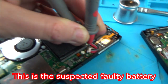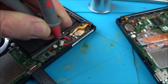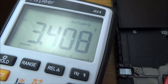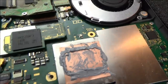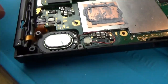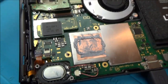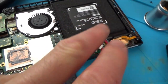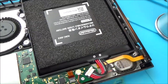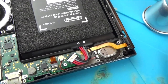Just before messing with the LCD screen, I'm going to leave it plugged in for a while — I've got to do a school run. It's now showing 3.4 volts, up from about 3.2 when I first plugged it in, and it's slowly rising. What I've done is disconnected the screen cable, because whatever the fault is it keeps lighting up the backlight, preventing the battery from charging. I've unplugged it, held down the power button, and it appears to have turned itself off. I'll leave this in for an hour or so to revive the battery.